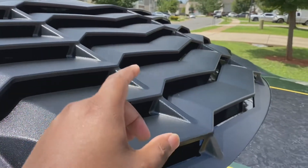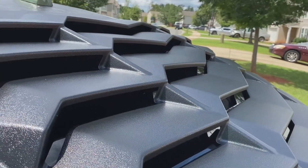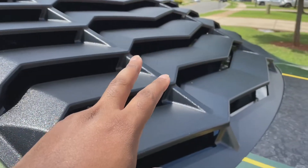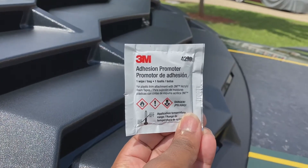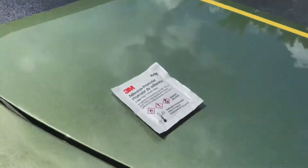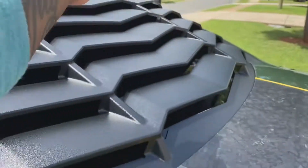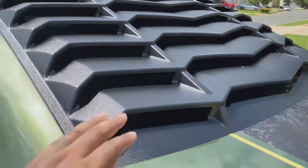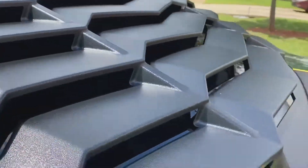I think that's the main issue with a lot of people having troubles with their louvers — it's just a straight plastic piece and you literally have to hold it down, push it down as you're applying it. I will say always have two people when applying the louver. What I did was I cleaned the windshield and then I used this adhesion promoter, which I'll post the link in the description as well. This adhesion promoter is clutch, man — this stuff has worked great so far. Simply all I did was clean the windshield and go around the outside of it with the sponge, just right along the outside of it. The good thing about it is it doesn't dry up quick, so I applied it and didn't have to do any extra pushing down until I had it where I really wanted it. Then me and my brother just kind of applied pressure around the ends.